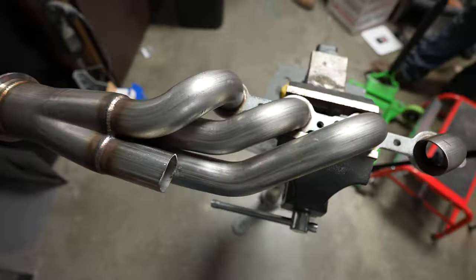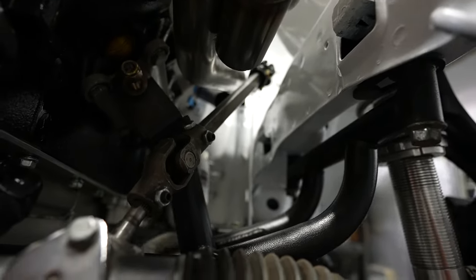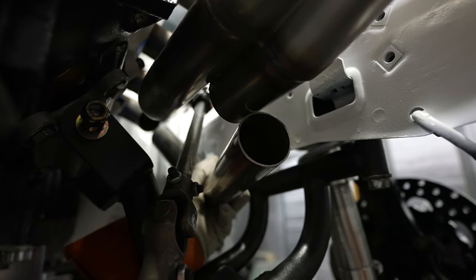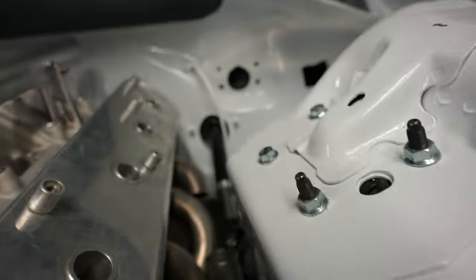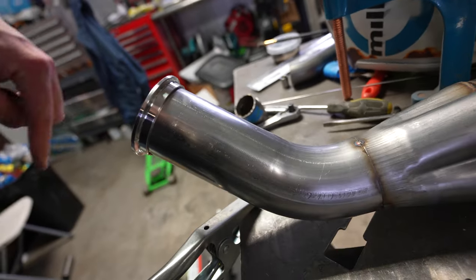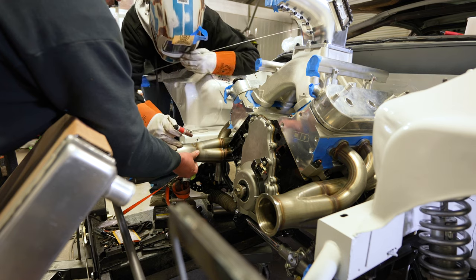Now we're missing a big piece — let's see if the header fits in the car now. It fits really nice without the rear cylinder tube. Two ideas forming: my original idea was to come out of that pipe, head back around the steering column, and then back up to the other pipe — that's how I'd do it if I needed to remove the header. Or I can come out of that pipe, head straight up right before it, then up and over the steering column and tie back into the rear cylinder. I went ahead and tacked the V-band on here and now I can set it back in the car.